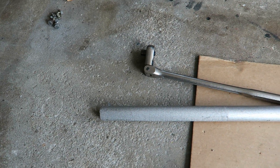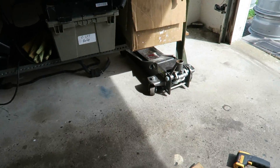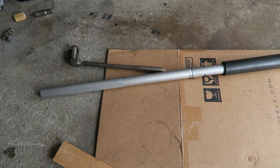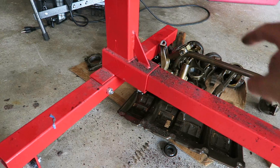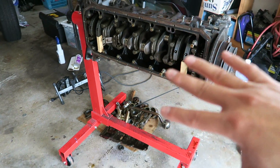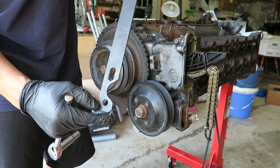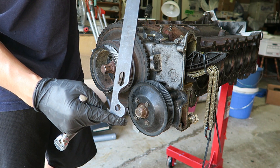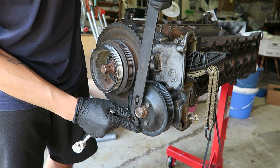Alternatively, I was ready to use this half-inch breaker bar with an extension from my quick pump jack. If you were to do this method with the long extension, definitely have someone else stand right there to prevent the entire stand from counter-rotating as you're trying to loosen this bolt out. So if you guys don't have an impact gun, you can use a lock tool to remove the fan in order to keep these bolts in place as you crack them loose so it doesn't rotate the water pump.